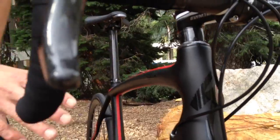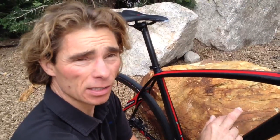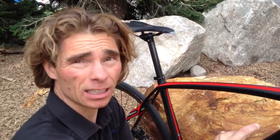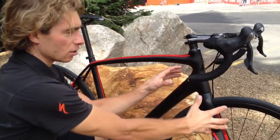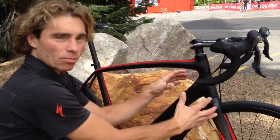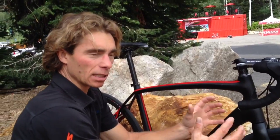One of the biggest innovations we have is 3 different bearing sizes for the 6 different bikes. So the 2 middle bikes share a bearing size, 1 1/4. The 2 lower bikes share 1 1/8, and the 2 biggest bikes share 1 3/8. What that allows us to do is really increase the size of this area of the bike to tailor the ride for that typical size rider for that bike. So the fork can be bigger for the bigger riders, and the appropriate stiffness is tuned for that rider. We wouldn't use that fork for a small rider, so we detune, we shrink everything, we design for strength and tune the stiffness for that.